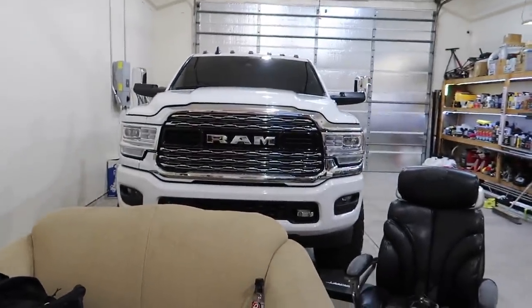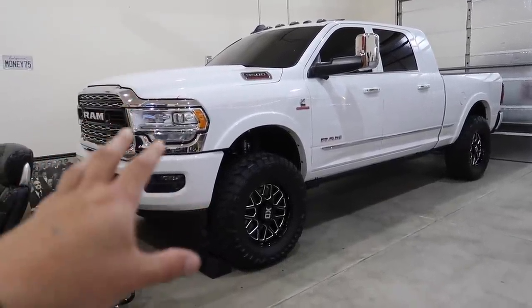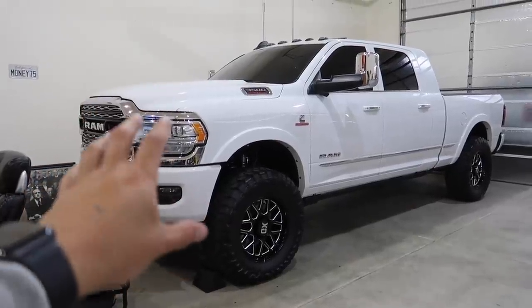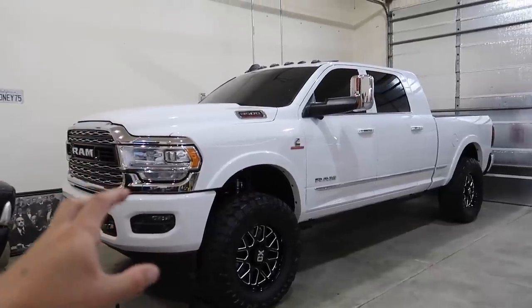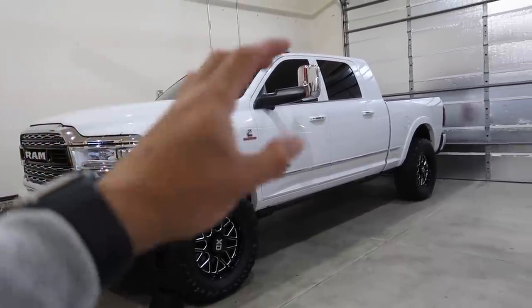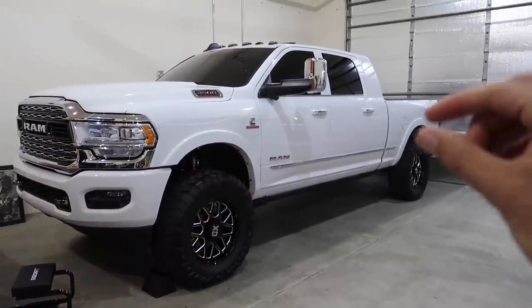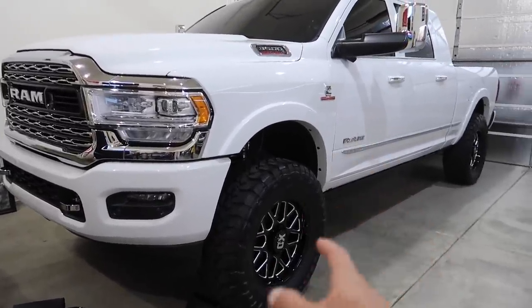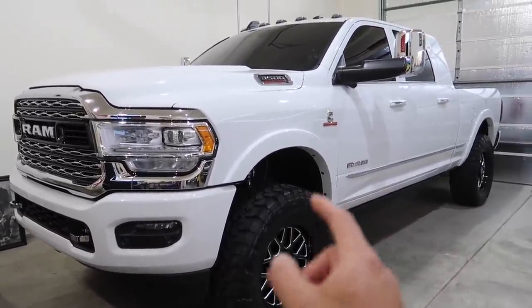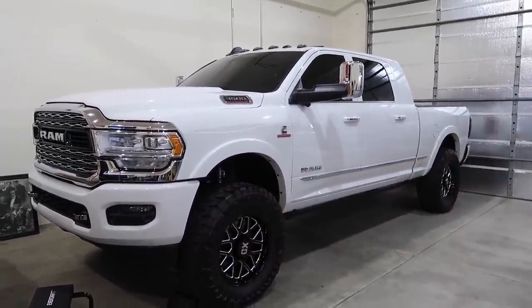First, yes the RAM is still doing good, I still love this truck, she's still running great. For you guys that keep asking me about the lift — the lift is a Carli three-and-a-quarter inch lift. The back sits about an inch higher than the front. It is on 37x13.50x20s with a 20 by 9 rim and a plus 18 offset.